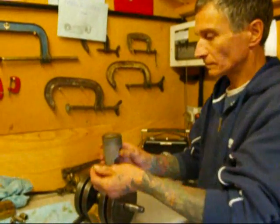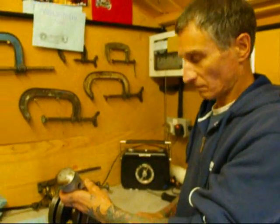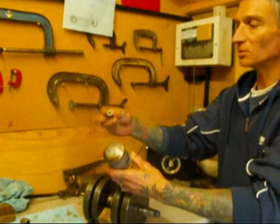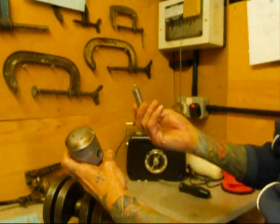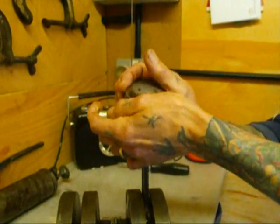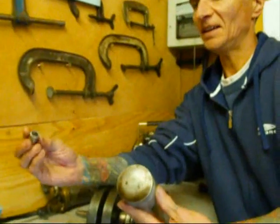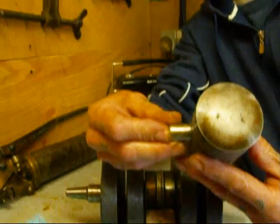So you've assembled the bearing and put it in the small end and put the piston on. Disassembling is another story, I take it. Yes, a much easier one though. If I get this tool, so we put the tool in, out the other end, and push the gudgeon pin out. There's this part of the tool with the recess. The recess end obviously goes over the grease nipple there.